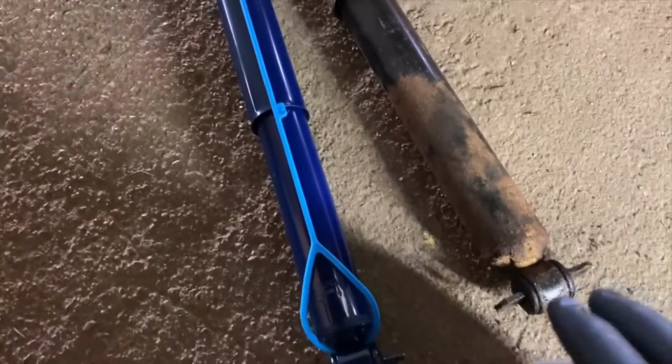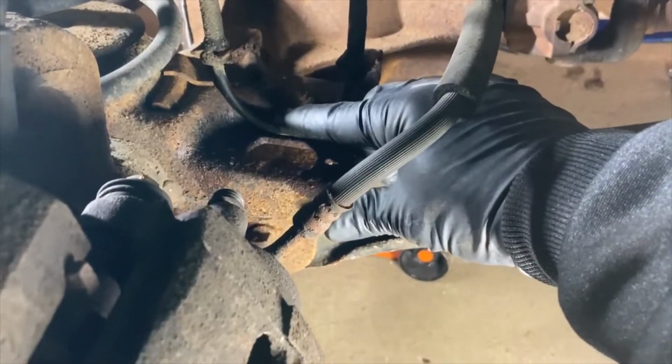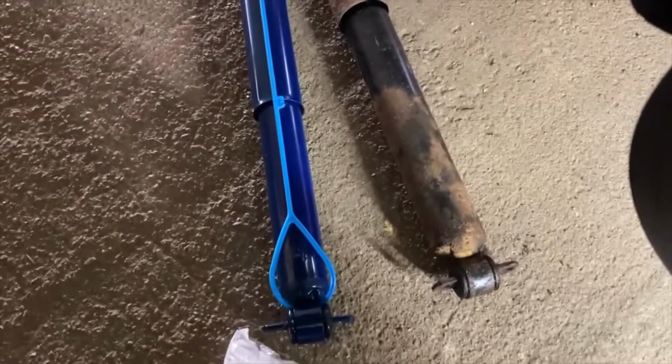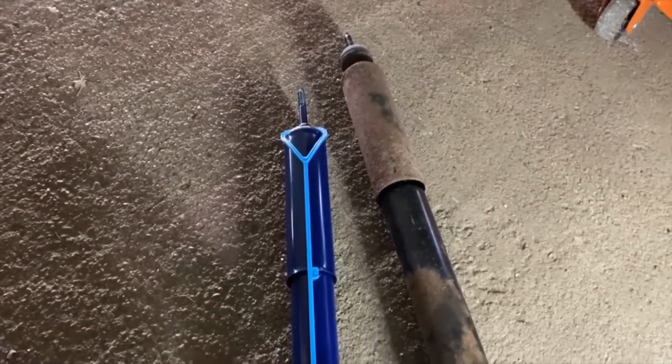They're a little nicer. They do give you a little bit more axle travel, like a touch more, because you're only basically raising the shock up about maybe an inch or so, just to get rid of that bar pin. It does make it a little bit easier for aftermarket shocks. If you have a lift and everything, doing aftermarket shocks, it makes it a little bit easier to find shocks that will fit, because they don't come with the bar pins from the factory. And I've put in enough of those, they kind of suck to put in.